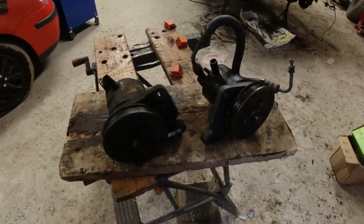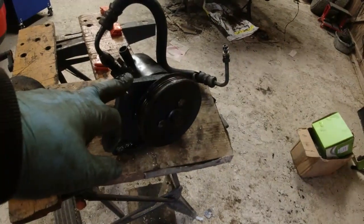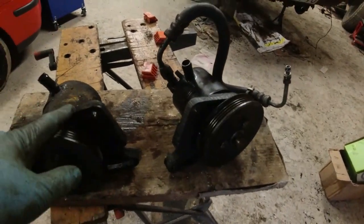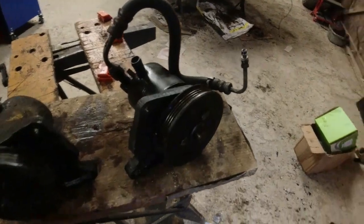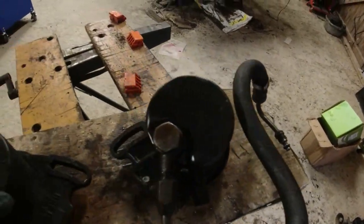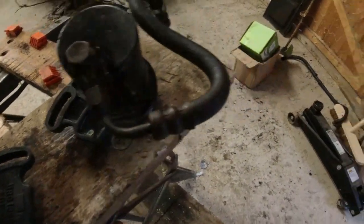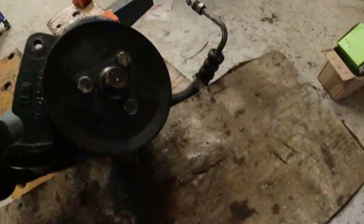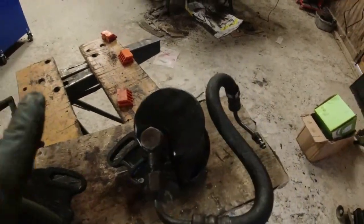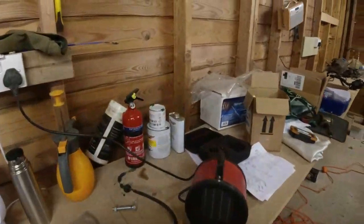Power steering kerfuffle. So that's the pump that came off the car with the bracketry as it stands. That's the pump I ordered in — used pump, doesn't matter, I always need these things on the shelf. This is the bracket I thought was unique to left-hand drive. However, when we tip this thing up on its nose and this one up on its nose, we can see — oh — they're mirror images of each other. Hang about one second. HRC 1688. Let's go to the other side of this one — oh, HRC 1688. Okay, that is turned upside down. That's not my problem. I've been forced to look at the manual, I'm afraid, folks.